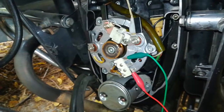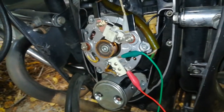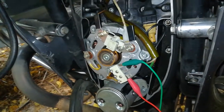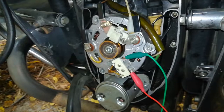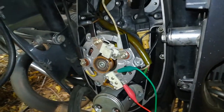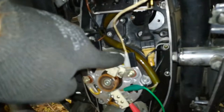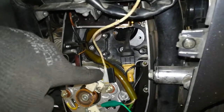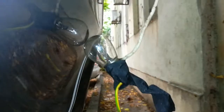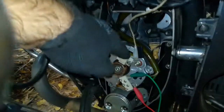I was led to believe that I might have a weird gremlin in the charging system that affects my ignition. I lose spark the instant my generator light goes out, so there might be something there. I have reason to suspect the regulator wiring to be bad, so I hooked up a separate independent DF line coming all the way through from the battery but running through a 21-watt 12-volt bulb. This way I'll magnetize the rotor but bypass the regulator circuit.